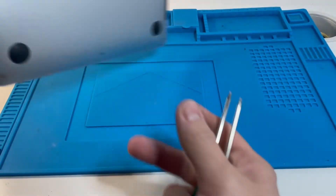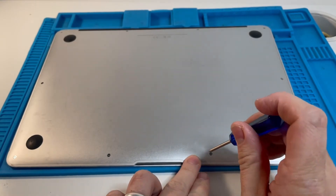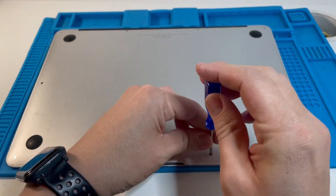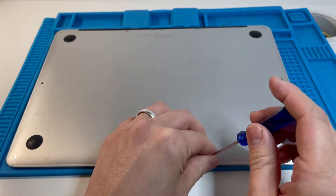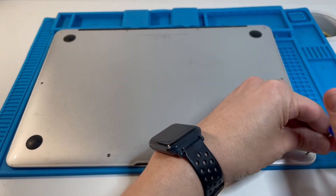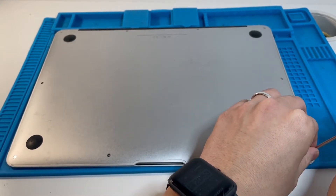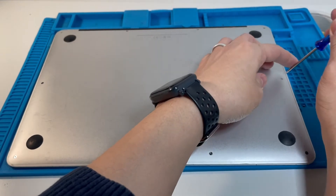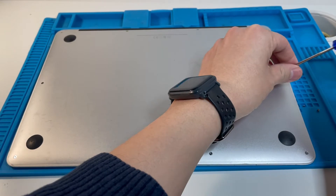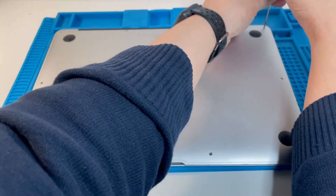The first thing we're going to do is flip this laptop over and use the Pentalobe screwdriver to take out the screws. The Pentalobe is a 1.2 Pentalobe screwdriver and it's basically only used in this particular MacBook and also the MacBook Pros from this era. It's good that they've included it, because it's very unlikely you can use this screwdriver anywhere else apart from one MacBook.